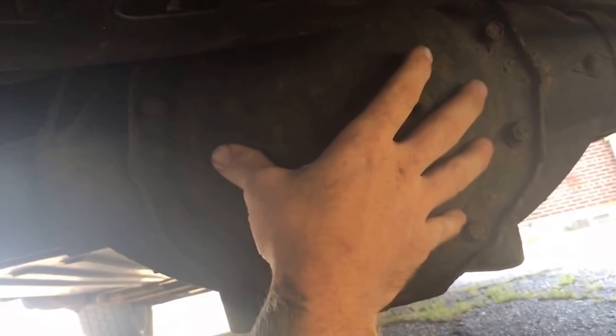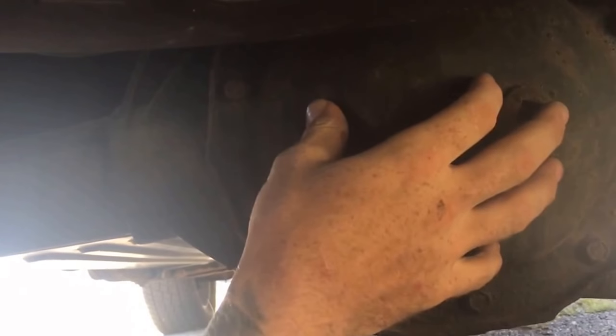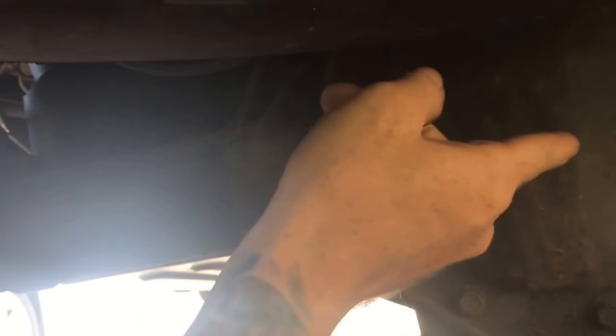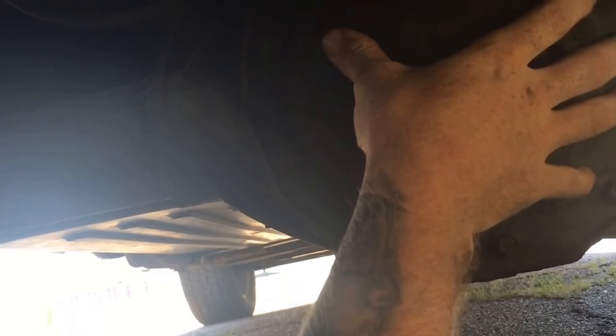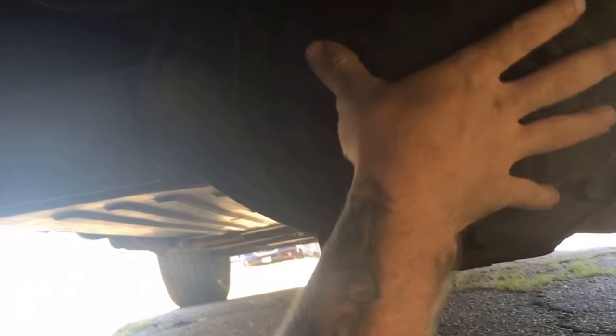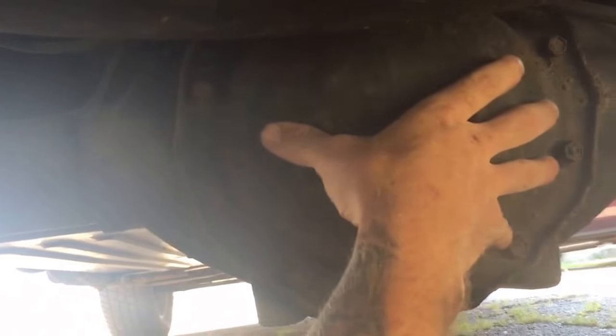The bearing cost about $15 and it did take about six hours to do. You pull this cover off — inside you've got the ring gear. I won't go through the full procedure, but if you can find a disassembly procedure for the Silverado differential, it's simple enough. Everything comes out, you bang the pinion bearing out from the front, press the new one in — simple enough — and sure enough, that solved the problem.